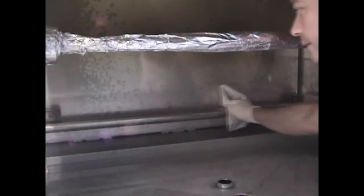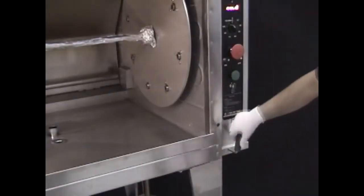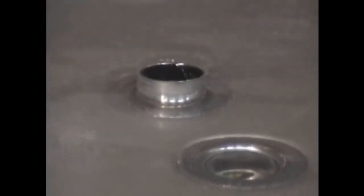A safety lockout is most likely caused by a wet burner. Open the door and wipe the burner dry. Make sure the drain valve is closed and open the water inlet valve. Fill the water pan to the top of the overflow drain. Once you complete this step, close the water inlet valve.